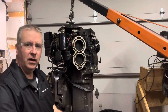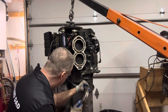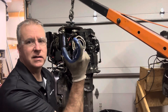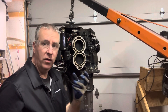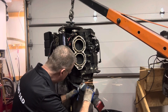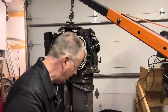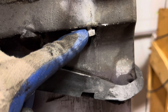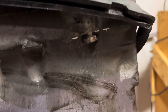I was able to slice a little with the cutoff wheel — I got one chunk out of it, so it's kind of a C-shape now. I'm trying not to damage the bolt because I still need a grip on it. I was able to get that lock washer out of there. Now I have that much room, so I'm going to put some lift on the hoist, get this rubber out of the way, and smack that bolt to see if we can get it to move.